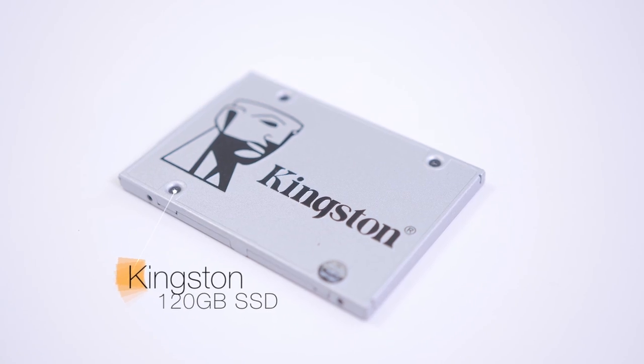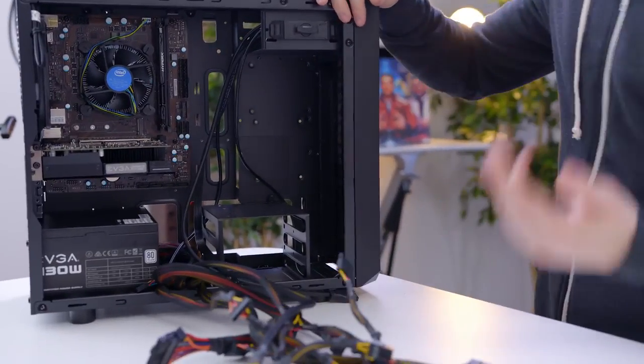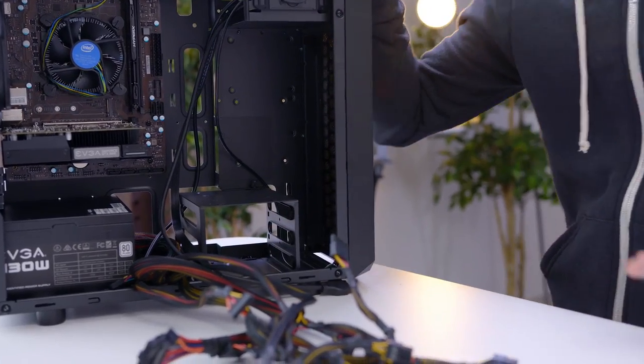And that is about it. Last but not least, we have an SSD — and yes, this is an SSD in a $400 system. It is 2017, and I am a firm believer that you should not be building a computer without an SSD. It makes such a huge difference to everyday usability: so much faster, so much less frustrating. For this, we went with the Kingston SSD Now UV400. The only real downside is that it's only 120 gigabytes, so if you don't mind going just a little bit over the $400 budget, you can upgrade this to 240 gigabytes. Or since this is a gaming PC with plenty of room for expansion, you can add an additional hard drive for extra games and files, so that you get the best of both worlds.